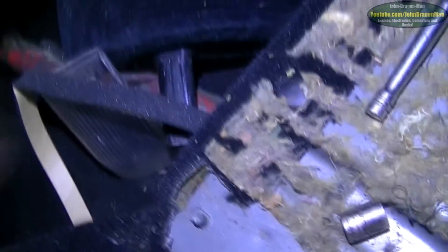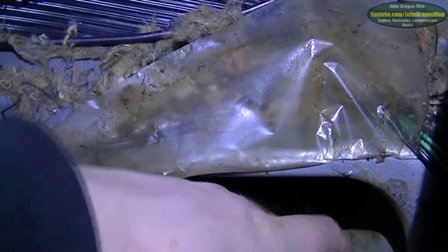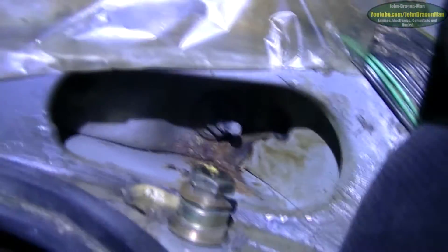We knew there'd be some, and I've got a trim tool to get these out. Headrests are in the way — everything you put somewhere it's always in the way. There's a bolt down there, don't know what that goes to, but we'll find out. The plan is to pretty much undo everything and then hope it falls apart. I'm a bit annoyed about finding that rust — it's in between a skin so it's going to be very difficult to get into to repair.